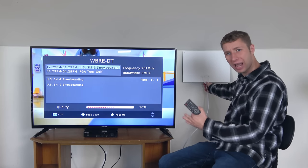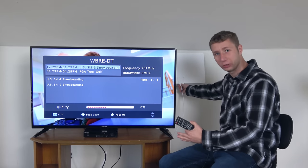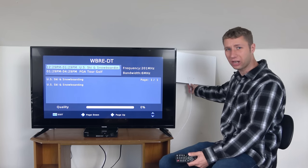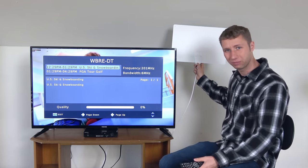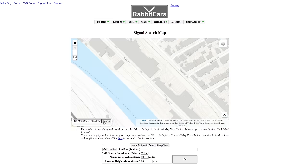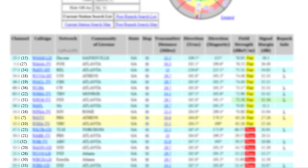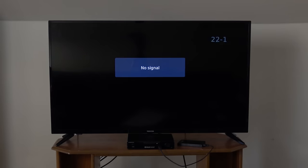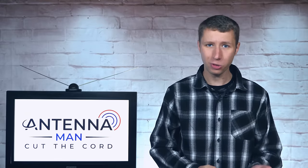Using the signal meter on this DTV box is really going to set you up for success instead of just moving the antenna around and hoping for the best. You can find the RF channels of TV stations in your area by running a reception report on RabbitEars.info under Signal Search and looking at the RF channel in parentheses. I noticed that this unit still has a glitch that previous versions had: if a channel drops out enough due to a low signal, the audio sometimes gets out of sync. This issue is easily fixed simply by rebooting the converter box. Most of you shouldn't have issues with dropouts as long as you have a good antenna setup.